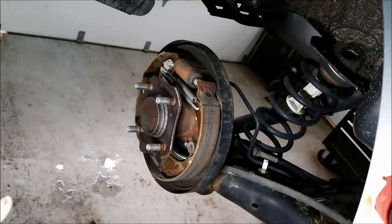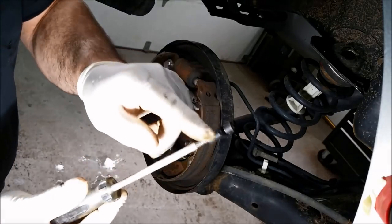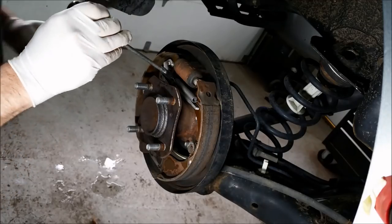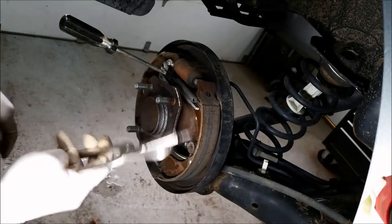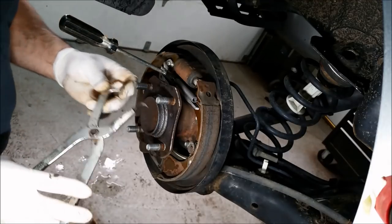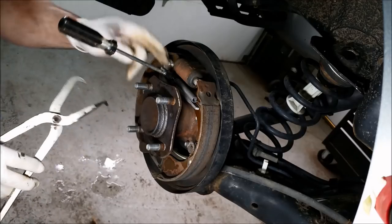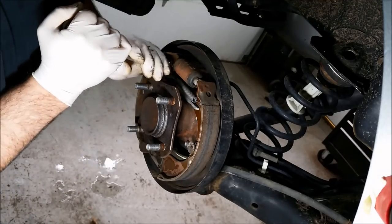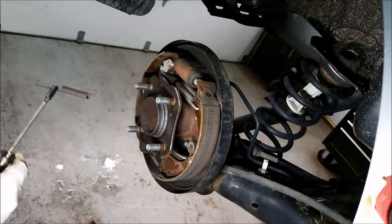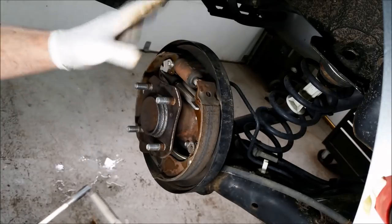We're okay in this case, so we're going to try to get this off. I'll use this neat little tool here that hooks the spring. We have the old-fashioned spring scissors which work well taking them apart — I'm not too worried about damaging the lining taking them off. Putting them back together, obviously I don't want to be jamming it into the new brake lining. It can be done gingerly if you do it right. Every car is configured differently in the way they put the springs on.